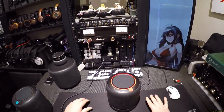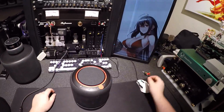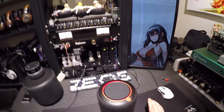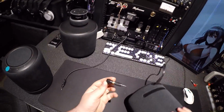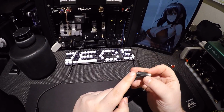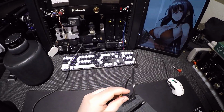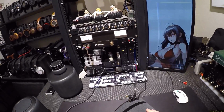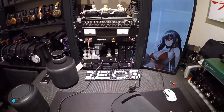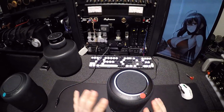Now here's the thing. I talk about DSPs, right? Digital signal processing. So if you put analog into this, like I was doing previously in my living room when I did the sound demo, there's a sound demo for these in the description, and there'll be a sound demo out tomorrow. I simply took an adapter, and I'll try to find these on Amazon to link them. It's a 3.5mm mono to an RCA, and then I had to adapt it to a right angle because it was being broken. I plugged that in, hooked this up to one end of a DAC, and the other one to another end of a DAC. And then I just had a stereo pair of speakers. They had individualized volume controls, as you can see here, and the ring, which is currently muted, I should say.